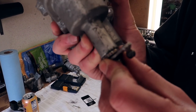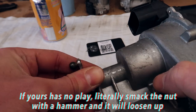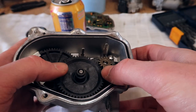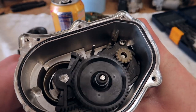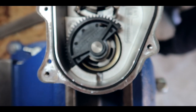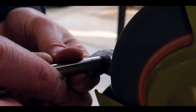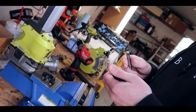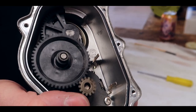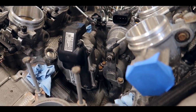Remember the movement we were talking about earlier? From the information I have, a healthy amount of play is anywhere from 0.5 millimeters to about 2 millimeters. This is just right under 1 millimeter of play, so that's perfect. Now at this point, we just put everything back together — this little gear goes right up in here. Everything is working nice and solid. And you do the exact same thing on the second one.